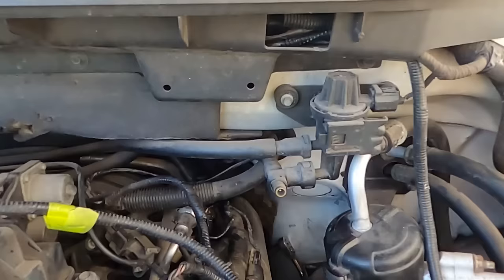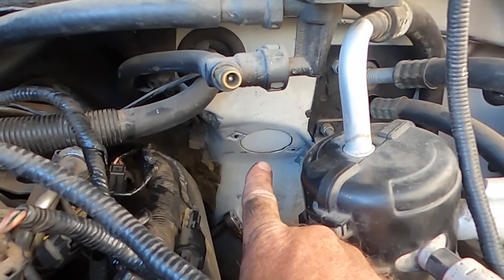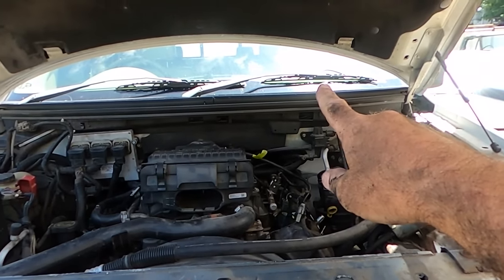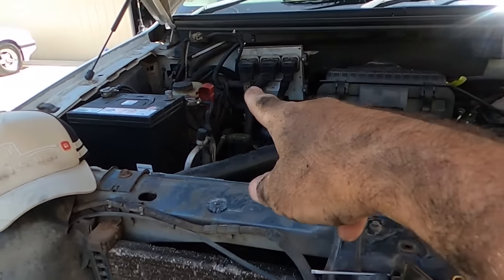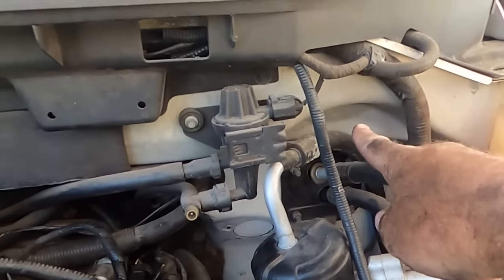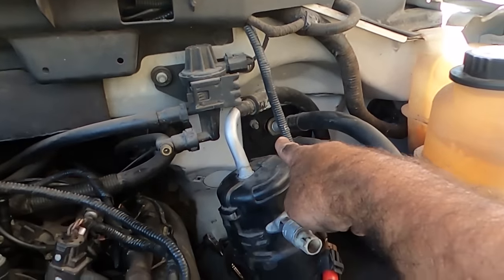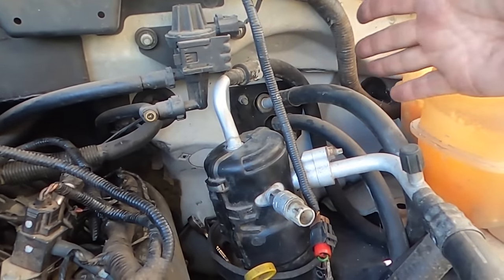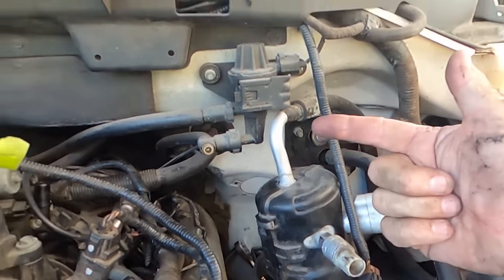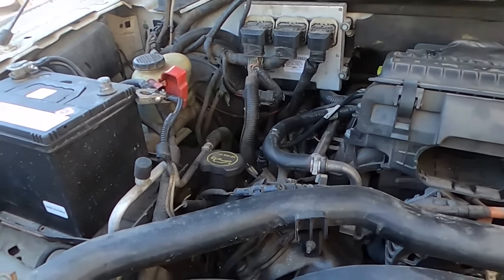So I'm just undoing the rocker cover at the back there. And see that plate? That's where the steering shaft came through. Because if you remember, I was saying they get converted from left-hand drive to right-hand drive. There's the brake booster. And if you look there, there's the recess for the factory brake booster. So that plate there has obviously been custom made to run the aircon on this side and then shifted the steering shaft and the brake booster to this side.